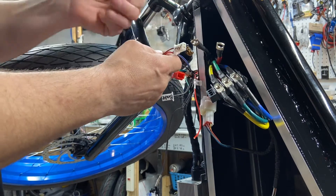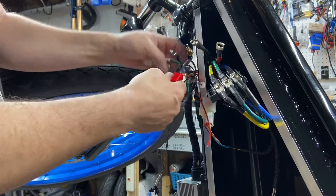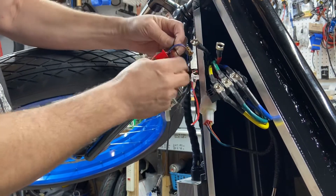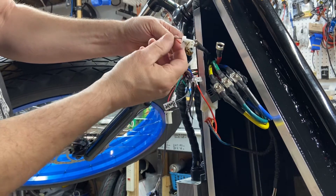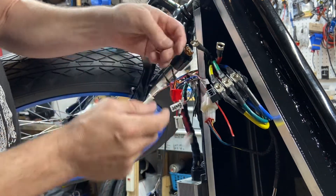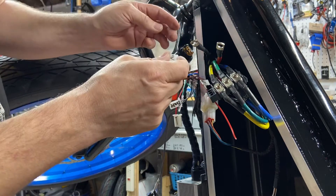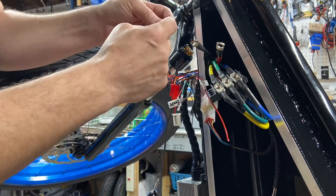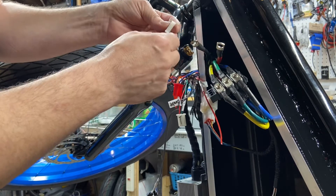For this controller, if you want to use the alarm key fob or a key switch, you just have to bypass using the alarm wires. There's a red and an orange wire — I gave myself a key switch here to bypass that. The key is a B-plus loop: when you turn the key it connects the loop. The live wire is the red one and the orange one is the switch.